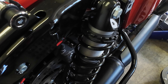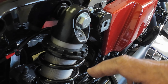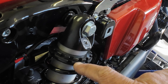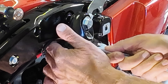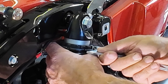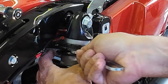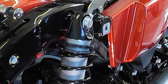Just like on an ATV or side-by-side with a simple suspension, this is the locking ring on the suspension. There's no preload on it now. Between the bottom of the locking ring and the top of the preload ring should be 15 millimeters — I'm going to use this tool to adjust it. So I'm adding preload, preloading the spring for my body weight and the weight of the stuff I carry. I'm going to do a little over 15 millimeters between the two. I can't believe that's how much preload they call for.